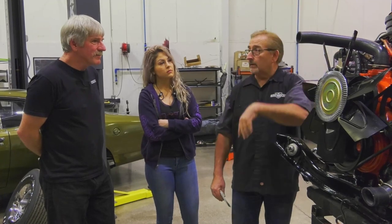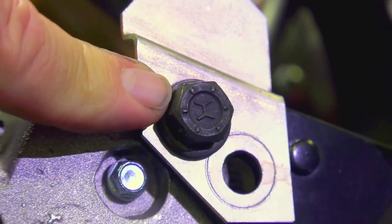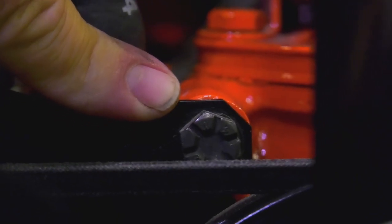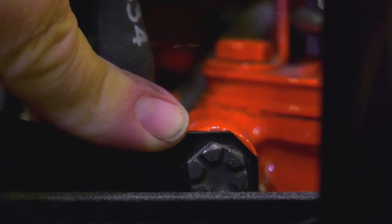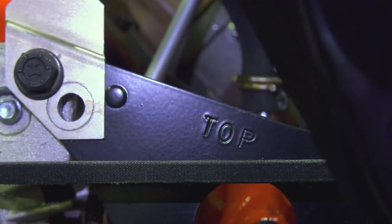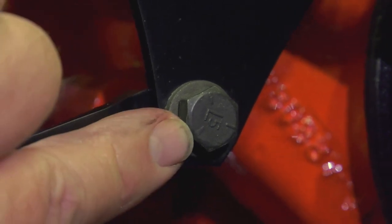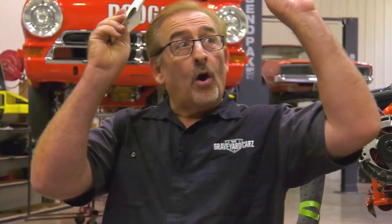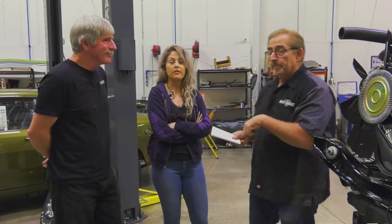This is original. That bolt — you see the 'H' in the middle? That's a Highland bolt — the correct original Highland bolt. Look at this one with the serrated top — the correct bolt, very short and specific, made to go into that hole. See the word 'TOP' here so you can't get it upside down. And down here you'll see L5 — the correct bolt that holds the lower pivoting part of the bracketry. When was that car built? September 2nd, 1969 — very good.